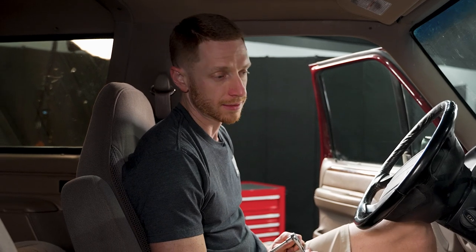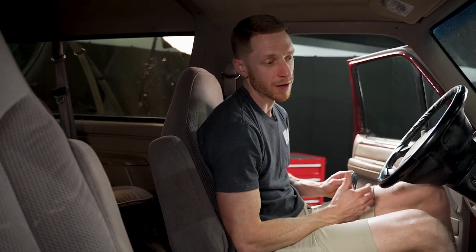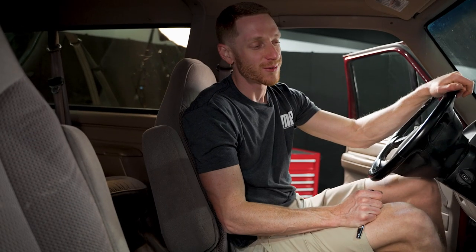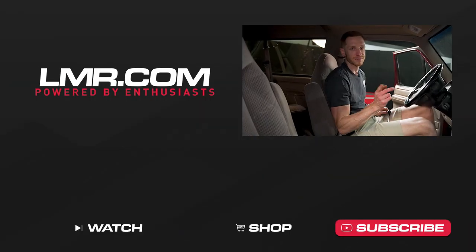That's a wrap. This is a great solution for the OBS trucks — it's a powder-coated bracket at the correct gauge, which gives it a lot of rigidity for a solid repair. All the bends, holes, and provisions are already there for you. If you run into the same situation we did with the vacuum position control plug-in, now you know how to make a repair. You could try epoxying another stud on the back, but let's be honest — it's old plastic and already brittle, so pay attention that you don't add further damage. As always, if you find value in what we do, subscribe to the channel, like the video, and turn on notifications. Until next time — for all things '92 to '96 Bronco and first-gen Lightning, keep it right here with the real enthusiasts at LMR.com.